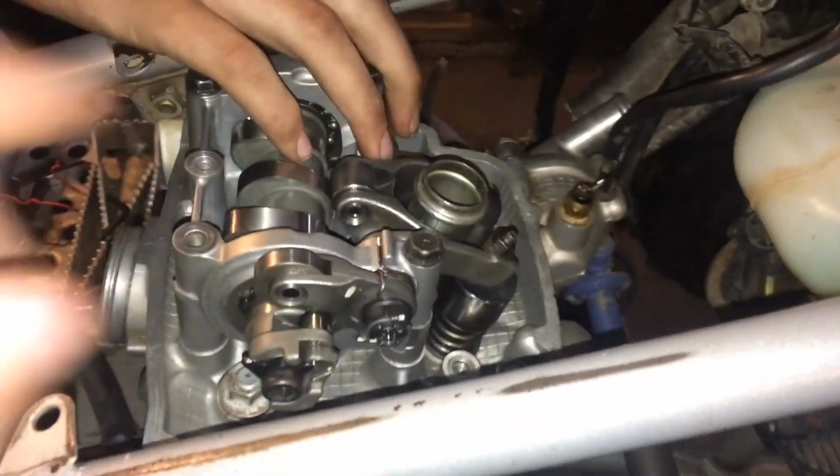So what we actually have going here is we got the screwdriver in there. It's actually dropped down a little bit. Looks real ghetto right now, but we have this turned in. It's holding the chain tension off it. I got tired of holding the screwdriver, so we put vice grips holding it there, and the vice grips are against the frame holding it from springing back on us. Again, we were too tight on the exhaust.